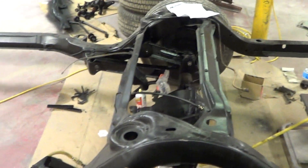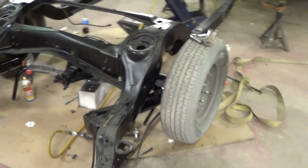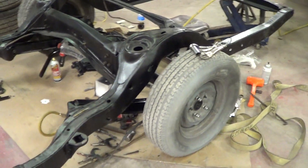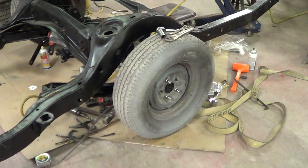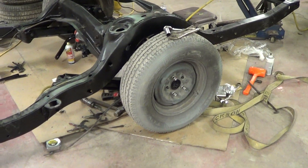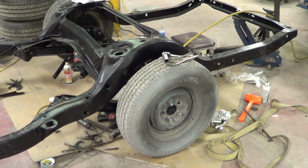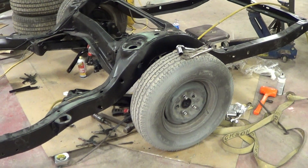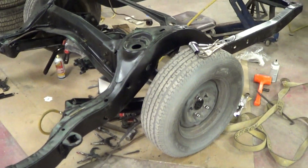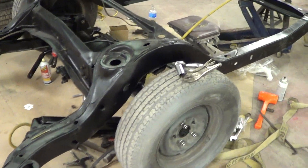The chassis is here right now — we've got it pulled up over here. The rear end has been cleaned and painted. John has already had the brakes gone through when they were driving this car, and the brakes looked good. There was one little thing that was broken — it was the automatic adjuster for the brakes. A piece had broken and we fixed it. So it's been painted and now installed.